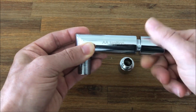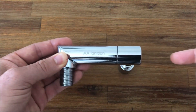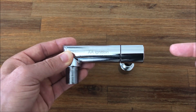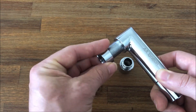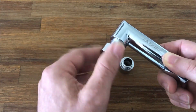The pieces included with the kit, as you can see here, screw into one another, and this allows you to adjust how far out the spacer is for clearance issues underneath the car or in the engine bay. The jam nut will allow you to properly orient the spacer when you're screwing it into the exhaust system.